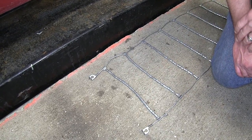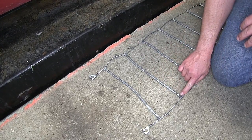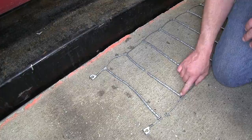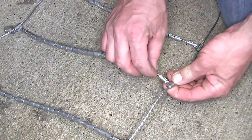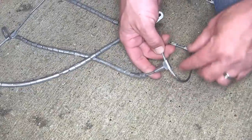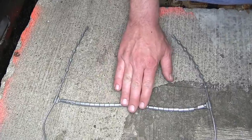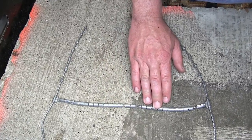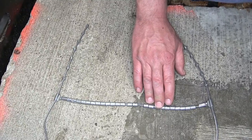To determine the inside or outside of your cable, we'll look at the cross link. Here at the end where it meets the outer cable, you'll notice that it's got a slight hook to it. We'll make sure that the hook goes away from the tire and our flat edge against the tire. Now here on our cross chain is also our case-hardened rollers, which are going to provide that additional traction in snowy or icy conditions.